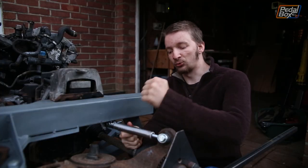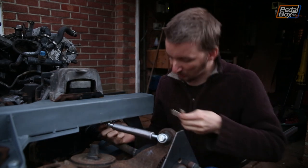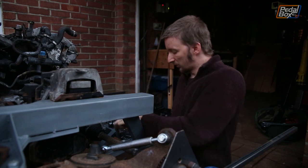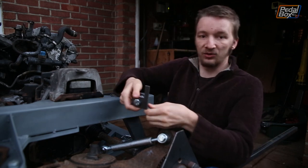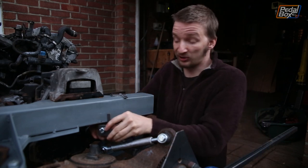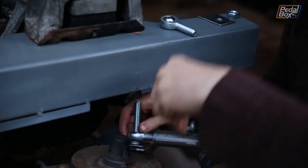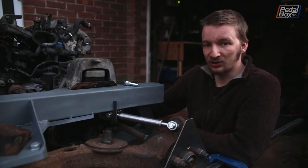We've settled on the alignment for this rod — 25 degrees swept back from the body. We mocked it up and made cardboard templates: one on the front supporting around the body, one on the back going in there, then transferred those to steel and made a stack that holds our rod end in place. The washers will be replaced with proper misalignment washers for more range of motion later. For now this all welds up in here with a couple of extra fillets to clean it up and join it nicely with the chassis.